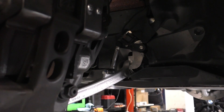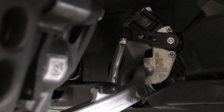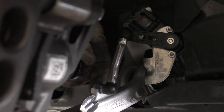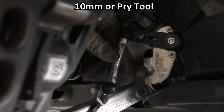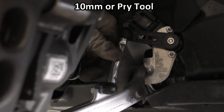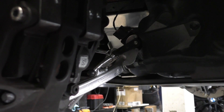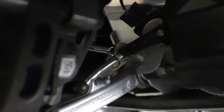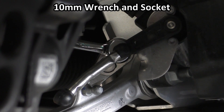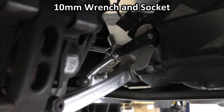On the driver side we're going to have to remove the headlight leveling sensor, which you can see here. If you're just replacing with a stock arm you can just remove this connection to the arm — you can either unscrew the nut on the back or use a fork tool to pop the plastic part off the ball. For the SPL arms we will have to remove the headlight leveling sensor from the stock silver arm using a 10mm open-ended wrench on the front and a 10mm socket on the back.